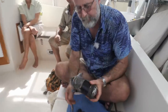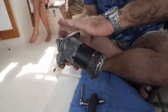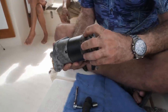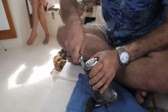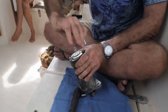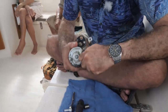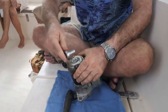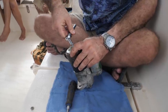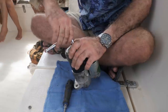How a starter is held together: these two long bolts go all the way through and thread into the casting on this end. You take them out, you take off this end plate which holds the brushes, and then we get to see the magic of what's inside. If you're taking one apart, don't take the brush holder screws off yet - if you take them off before you take the other part apart, things go flying inside and something might get broken.